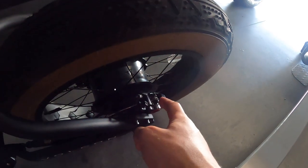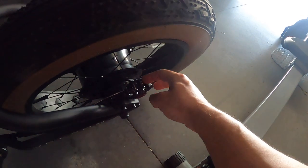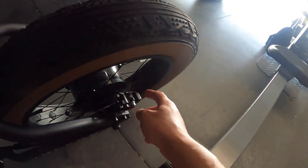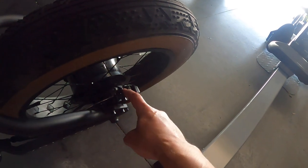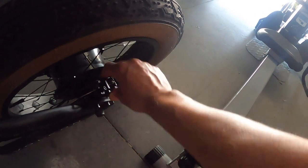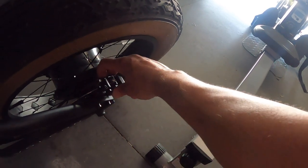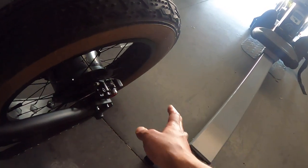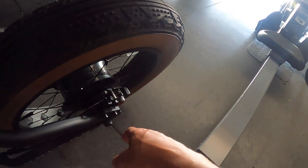I found out it was the rear brakes — the pads appeared like they were contaminated, they started to crumble, and the squealing got worse over time. I noticed that the caliper has two nuts you can loosen to align the adapter piece. I did that per the service manual that Vulcan gave me, but that did not change anything.